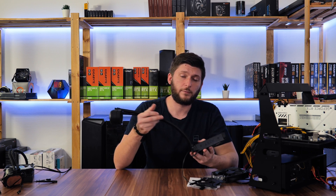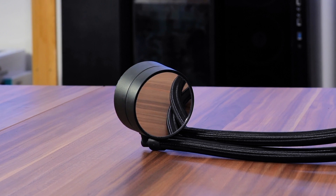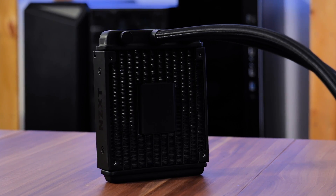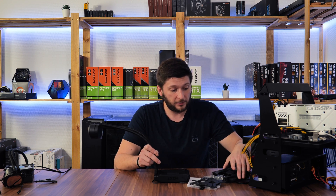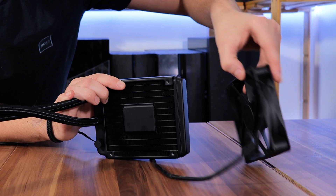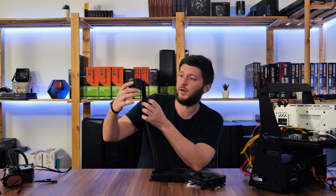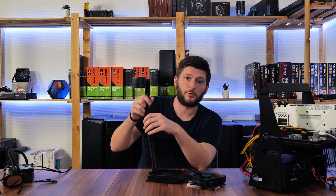If we look at the all-in-one itself, there is one big difference from what you're used to. Instead of putting the pump in the water block like usual, NZXT placed it inside the radiator. When it comes to water flow, I don't see any reason why this should be worse. And for heat dissipation of the radiator, the middle section is blocked off by the fan motor anyway, so overall the pump placement will likely make no difference — maybe a degree, but nothing outside the margin of error. The tubes are sleeved and adjustable at the water block, and at 400mm the M22 provides the longest tubes.